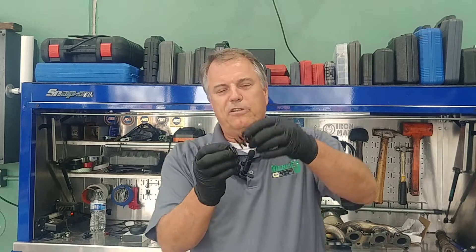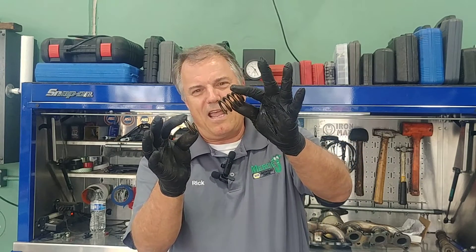In this case you can see this spring is broken in half, so it doesn't close the valve. In most cases you just have a misfire — you replace the spring and get it handled. If it goes for too long and the valve doesn't close often enough, then the valve can burn.